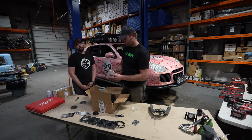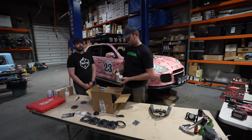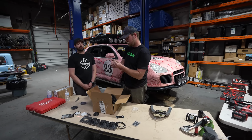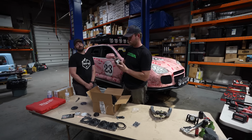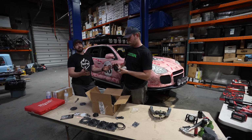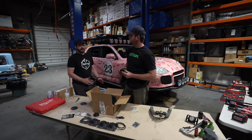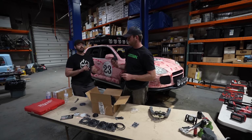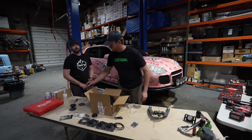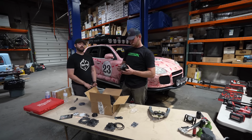Nice. We've got Porsche parts. What are they? So that's an option when you order our lift kit. You can spec to order it with the factory strut mounts. When we install this lift kit, we disassemble the strut to a point where the factory strut mounts are exposed and only hold on by 1 nut. And we recommend highly every time, if you haven't replaced your strut mounts, to do them there. We've seen pretty much in every car that hasn't been serviced or taken apart, that either the strut mounts have cracks in them and are starting to tear, or we've seen complete failure where the center section metal bonded is separated and causes a lot of clunks, and handling characteristics are just not where they need to be.